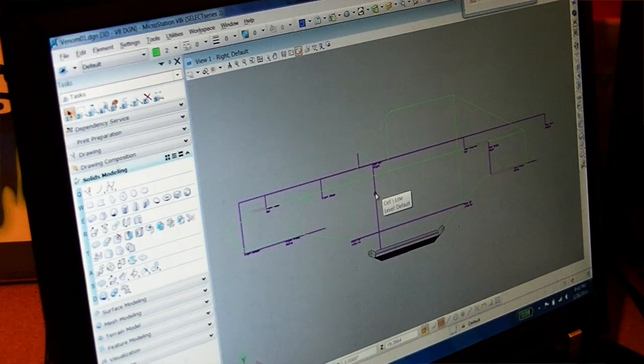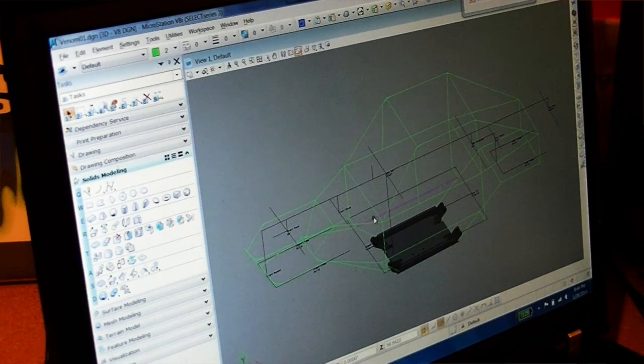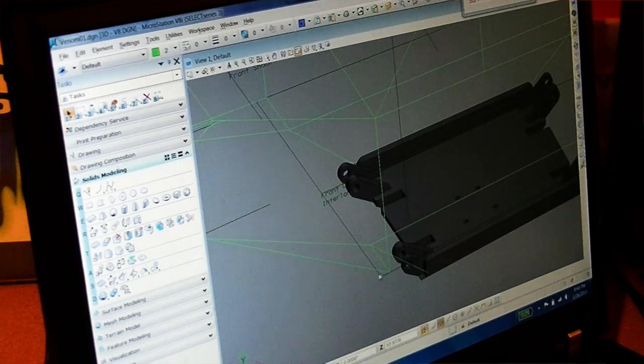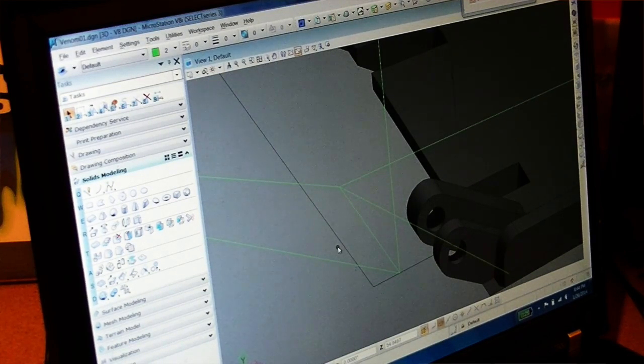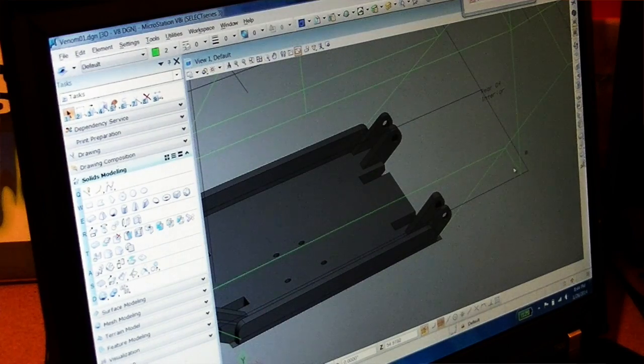I've then brought in those control points and make sure that the points I'm hitting with the chassis profile will work with the design of a Wraith in general. Some things have to be adjusted to get the very basics of the chassis to work — length, wheelbase, height, suspension geometry, and servo clearance, meaning when the axle comes up at full bump or articulates, the servo needs room to move. I also made room for the original Wraith interior pan. This black line is the original front of where that Wraith interior pan should go, and I had to move it back just a hair to meet proportions.